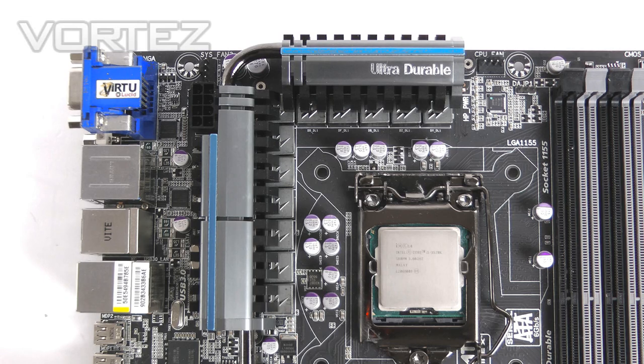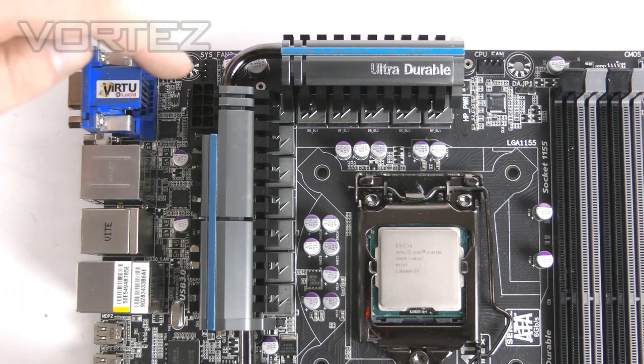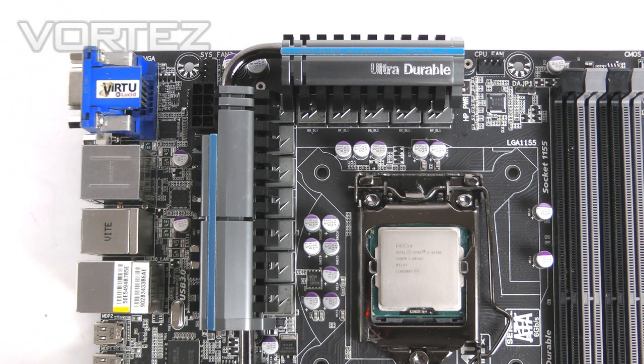We're going to take a closer look at all the features on this board, starting with the CPU socket. This is LGA1155, so we've got support for Intel's second and third generation CPUs — Sandy Bridge and Ivy Bridge. I've actually got an Ivy Bridge chip already installed. Around the CPU socket we've got eight CPU power phases, an additional two for the integrated GPU, and another two over towards the memory. We've got two heat sinks covering the MOSFETs with a single heat pipe running through to the Z77 chip heatsink. Behind here we've also got eight-pin CPU power, for that extra juice for overclocking.